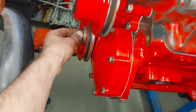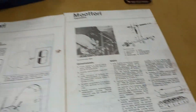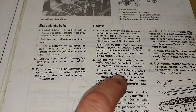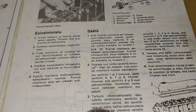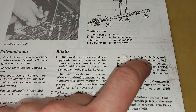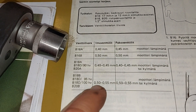I've turned the crankshaft pulley so you can see the zero mark, and I check that valves number 1 and 2 are rocking. I have a manual here — sorry, this one is in Finnish only, it's a do-it-yourself handbook for Volvo owners. First I check that valves 1 and 2 are rocking, then I adjust valves 4, 6, 7, and 8. Then I rotate the engine until it's at the zero spot again and adjust valves 1, 2, 3, and 5.